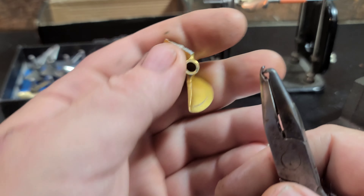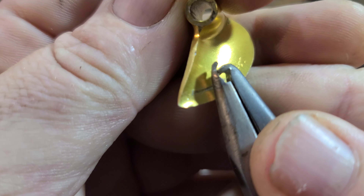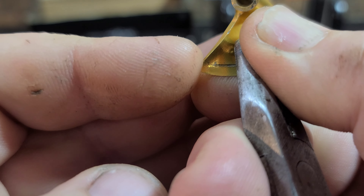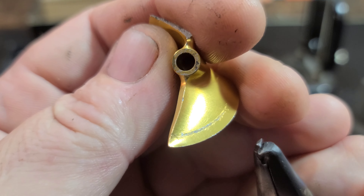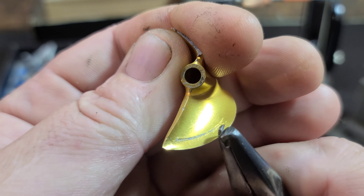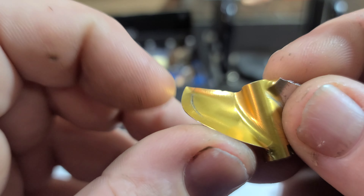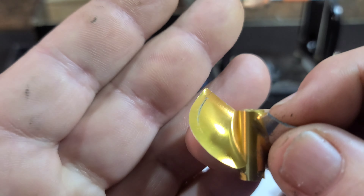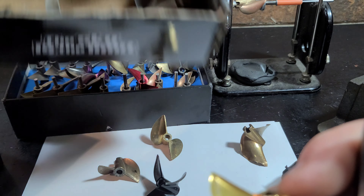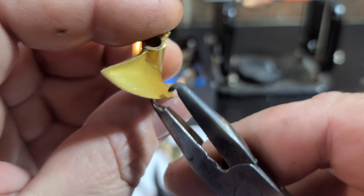I made the pliers, and what I like to do with my props lately — especially these high-rake props — I've been trying to cup basically from right where the pliers grab to the tip. That's actually been working out pretty good. If you cup too far up on the prop you're going backwards. This prop is aluminum — I don't recommend bending aluminum; it's going to break eventually. But I've been using aluminum props as my test bed for the pliers.